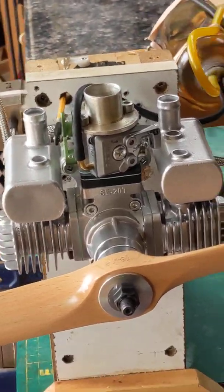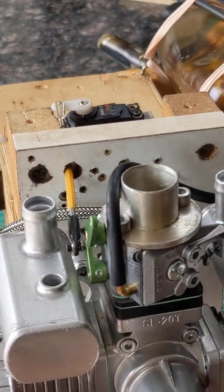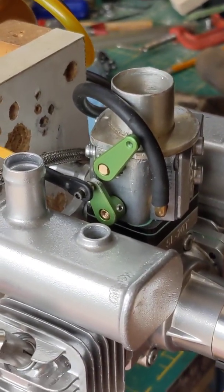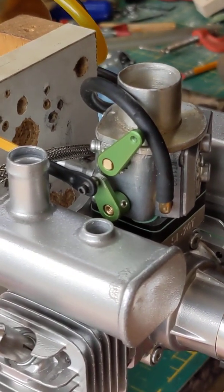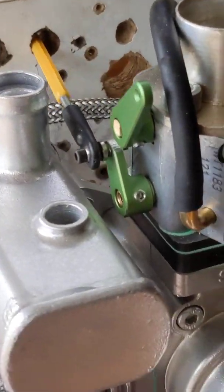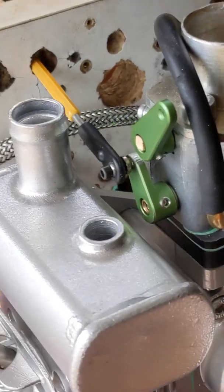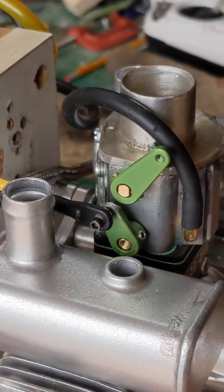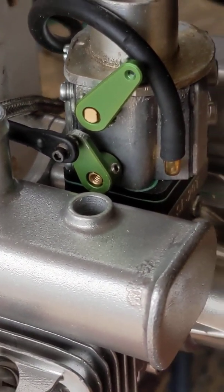Initial thoughts on this engine: it looks good. It's got some fantastic compression out of the box. We added a velocity stack to it. We've got our throttle arms set up, which there are a couple of small, nitty little things with this engine that really take a little engineering — the throttle arms. I've got two different sizes and they either hit each other or you're trying to tuck them down behind the muffler where you can't reach them. Sometimes the one I have will hit the back of the muffler. So the best solution I came up with was a left one for the choke, and I cut the throttle one down and re-drilled and tapped the holes so it now clears.